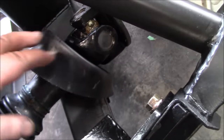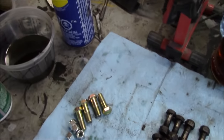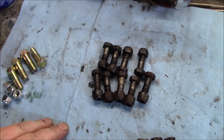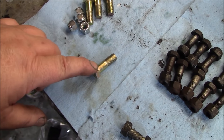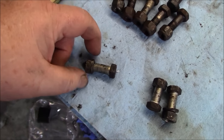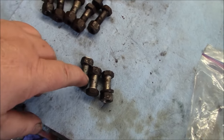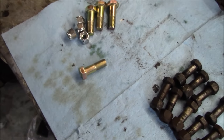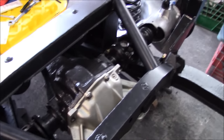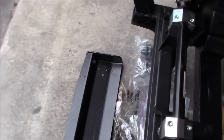We're going to put a couple of bolts in the differential-to-axle flanges. One quick word: these are specific machined fasteners for these axle flange locations — they have a little shoulder on them. The old hardware that came out is not correct — don't just replace with a regular threaded fastener because that'll wallow out the holes and you'll have bigger troubles. Get the correct machined bolts. Two fasteners in on each side should do for now, just to keep those axles off the frame when I move the car. We'll go back and add the other bolts and torque them properly, although you can't really get a torque wrench in there.